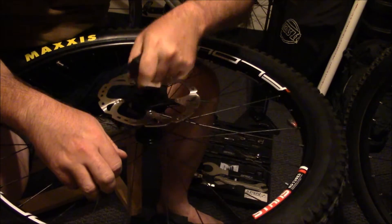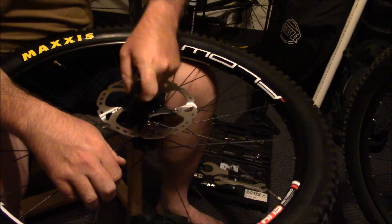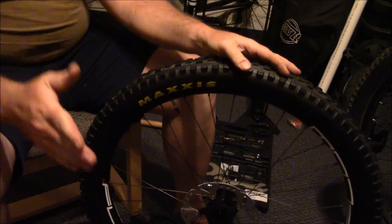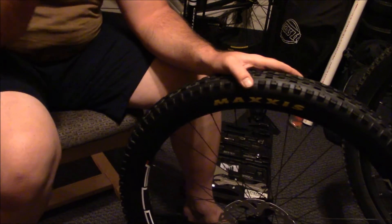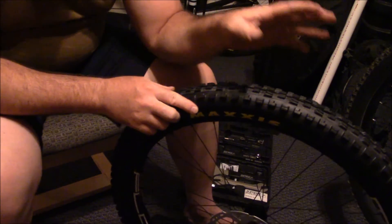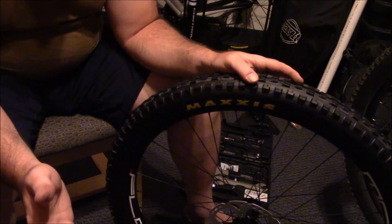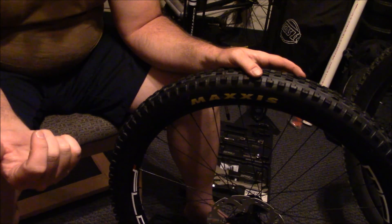The reason we go in a star pattern is so they get even tension on the points — you don't want to over-tension one side. Get them all tightened and then torque them afterward. Okay, so that's it for our wheels! Hopefully you guys enjoyed this video — if you did make sure you give us a thumbs up. We have one more video to do: putting the wheels on the bike, and we've also got to swap over the adapters for the new fork. As always, make sure you click that subscribe button — we have hundreds of videos on the channel. Keep riding!